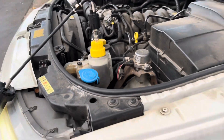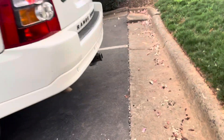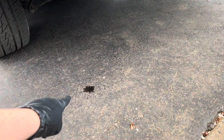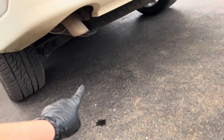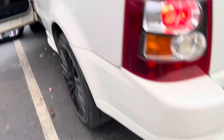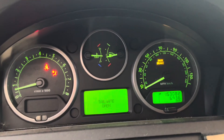This wasn't doing it before, so this might be a good sign and a bad sign at once — this might be a head gasket leak. We have water coming out of the tailpipe, starting to drip down. This wasn't happening before. This is really starting to look like a head gasket because before it was not even bubbling. Let's look at the temperature gauge again.